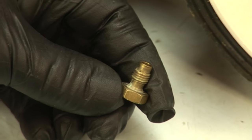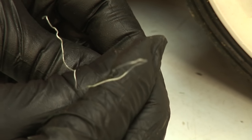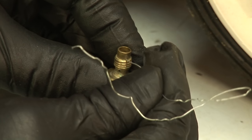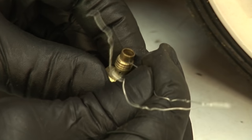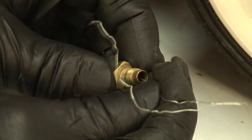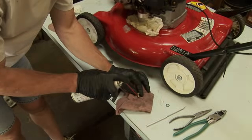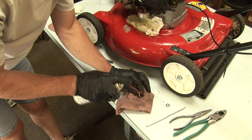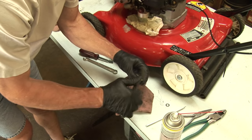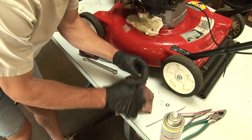You want to make sure that jet is clean. The way you do that is get a piece of small wire and poke it in and out of that hole to make sure it's clean. It's really imperative that that hole is clean. Run the wire through there and also through the hole in the middle. Spray a little bit of carb cleaner on the jet. If you don't have carb cleaner, you can just use a brush — the carburetor cleaner just helps get a little bit more off.